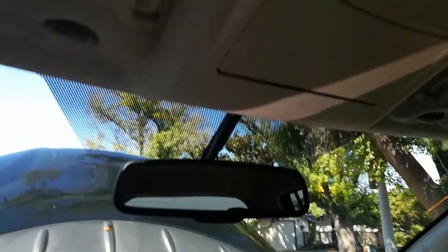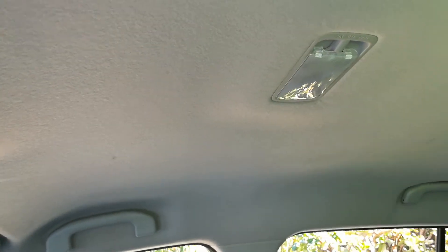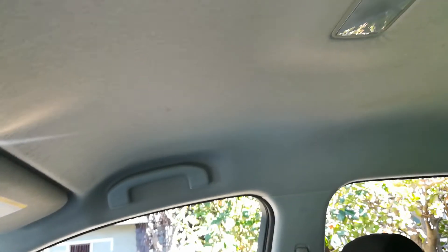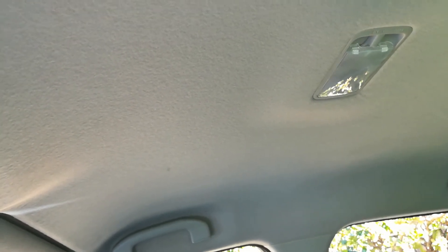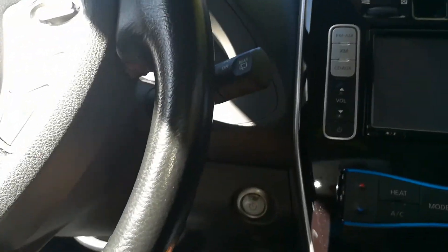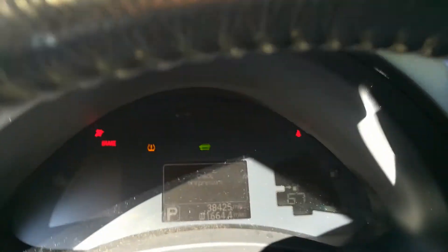You want to make sure to find out why the battery died — if you had left a dome light or something on, you want to figure that out. This is the original battery on the car so it's getting a little older. The 12 volt battery just goes out like any other car; I'll have a link to a battery I recommend. You want to get the best battery possible for the Leaf because the 12 volt battery actually does a lot. I'm going to put my foot on the brake and hit the start button — and there it goes. My Nissan Leaf has started.